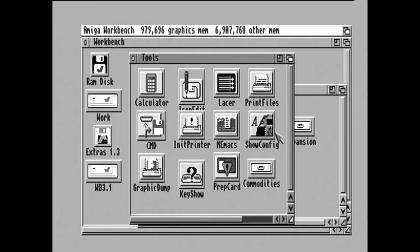No, I have the 512 oh. I forgot, the ACA500 does some weird stuff with your trapdoor memory. Okay, so I have a 512 expansion card in my trapdoor for the Amiga. The ACA500Plus has a RAM expansion on it, I believe. I actually don't remember the specs on memory expansion, but I'm fairly certain it does actually have like 8 megs on it, or something like that. And then what it does is it converts your trapdoor memory, instead of bypassing it or locking it out, it actually converts that into fast memory. Which I don't know what fast memory is, but apparently that's a good thing.